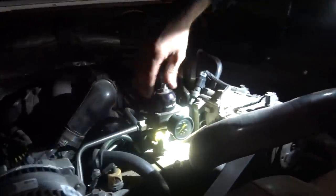Regulated, but the fuel lab running about 60 pounds in this one. Runs down soft line, comes underneath the truck. Well, my truck's running dirty. Hey, look, but it's got dual Baldwins, billet distribution block. My 2 in the morning ghetto make it work. You can maintain both tanks. It runs a Bosch style pump, good up to like 600 horse. Yeah, we're already at like 1,000 horse.